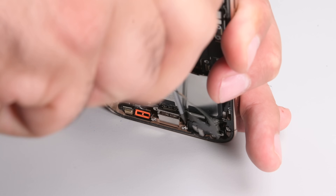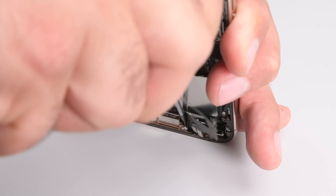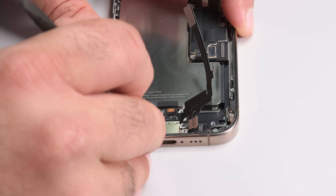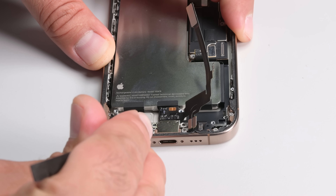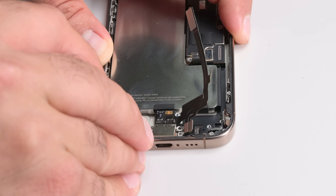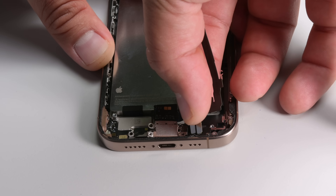I need a fixed-blade driver to get to the two recessed Phillips screws on either side of the housing if I'm not removing the battery first, but it's entirely possible to do this. This is the first time I haven't had to remove a bunch of components and a dozen Phillips screws, tri-point screws, and standoffs just to get to the USB-C port. It's a massively simplified design — unfortunately Apple doesn't seem to have any intention of selling these ports as spare parts.